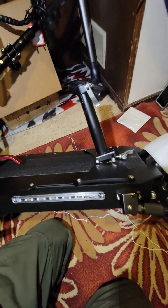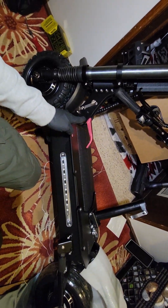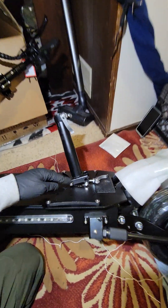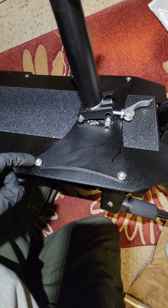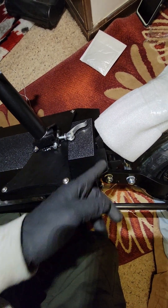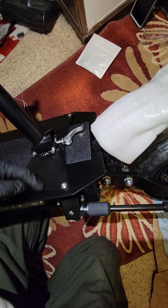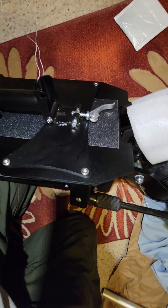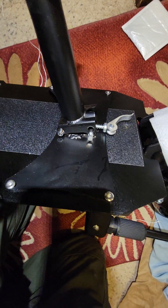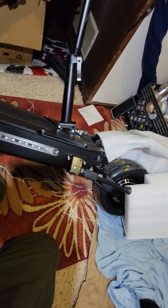See how this seat is so short from here to here, and the handlebars are going to be real tight — it's going to be real close, bunched up. Here's an idea: take these bolts out and move this whole seat back. Look at this — you can get another hole, move it on back, then drill two new bolt holes here and here, wherever it's going to be. Lock them in on both sides. That gives you more comfortable room and makes it better to drive. You can modify these things.